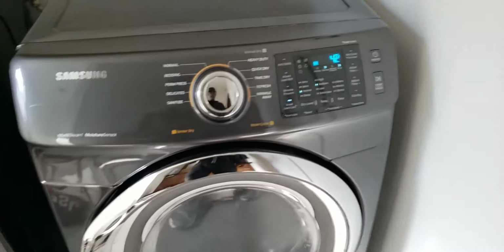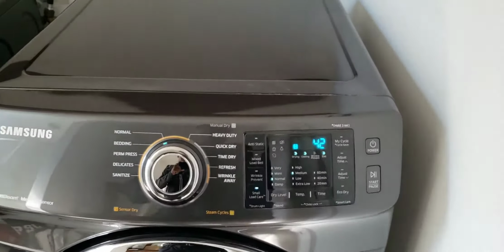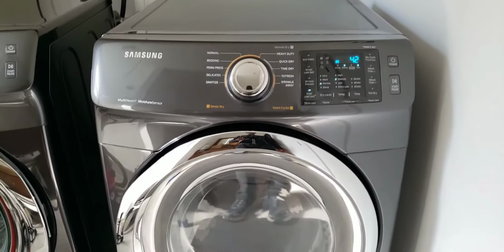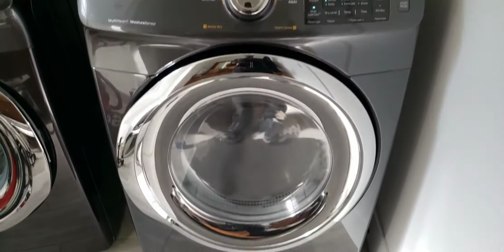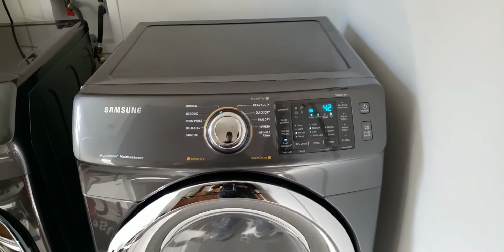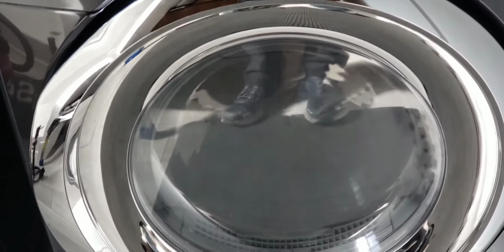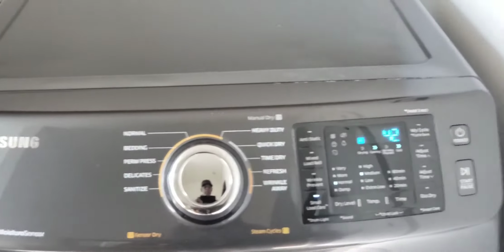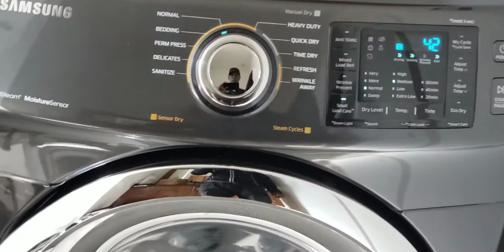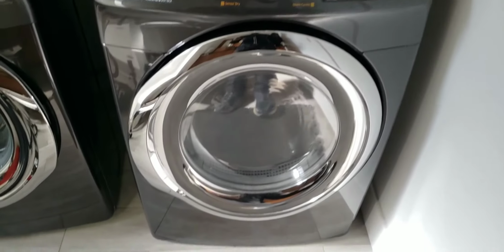Motor has a feedback noise at start. After about 15 to 20 minutes, the dryer will turn itself off due to the motor getting hot. Completely disassemble, locate motor, inspect motor, identify problem, replace part if necessary.